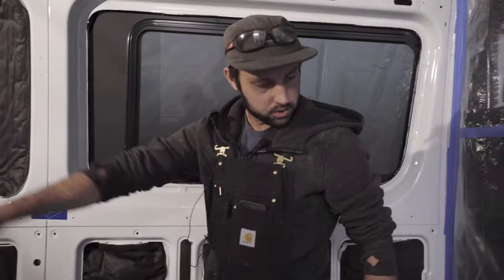And on this side, we brought it in around the wheel because all of our electronics are going to be living around here. So in the winter, we want to keep them a little bit warmer because we are doing lithium batteries, which means we need to keep them warm in the winter to charge. So this whole area is going to be nice and toasty. It's going to be fantastic. So we did cut out the floor here, and this is to give us access to where our floor heating basically starts and terminates, which is where also the hydronic heater is going to be under the van.